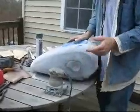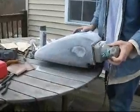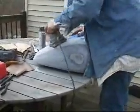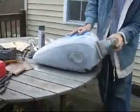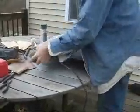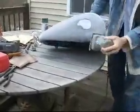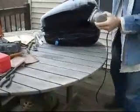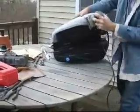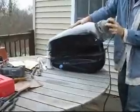Generally speaking, the tank is steel. It's relatively durable. And so move quickly and evenly across the surface. Basically, you want to move quickly, and you want to have a grit of paper that's going to cut through the clear coats and through the color and get you down to your working surface as soon as possible. The best grits for this job start somewhere between a 36 and a 60 grit to cut through the clears, through the color, get down to metal. That's the way it ended up with this job, with the scratches and the dents. It inevitably was easier just to get down to metal.